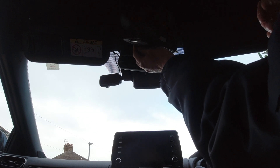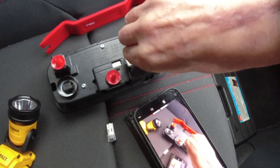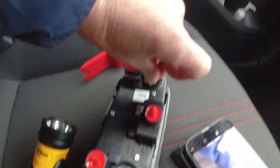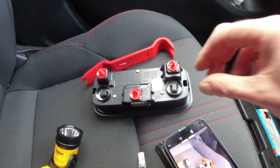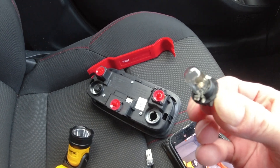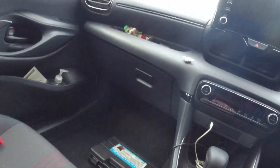So I'm going to change this one out now and show you how to do that. What you're going to do is twist that out — it's hard to do with one hand. I'm going to put you down, twist it out, and I'll show you the bulb connector. It just twists 90 degrees. I've managed to twist it 90 degrees — and that's the holder. Let's set the camera up and see if I can show you changing the bulb.